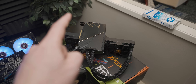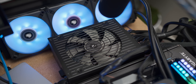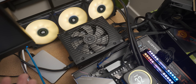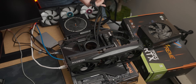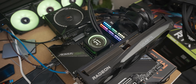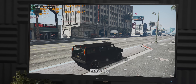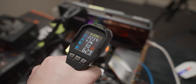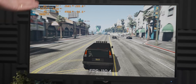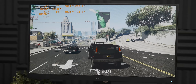One thing that concerns me is there's pretty bad coil whine on this graphics card — worse than the 3090 Ti had. It's so bad the power supply is screaming like a cat with its tail caught in the door. So the next thing I tried was replacing the power supply. Even with a new power supply it still sounds like a Geiger counter near the elephant's foot and it hasn't helped the power draw figures. It's really weird because the backplate gets scorching hot, but if you check all the temperatures they all seem normal, and it's not throttling — it just goes straight to 290 watts and sits there. I think I'm going to have to get a different BIOS for this card otherwise we're stuck.